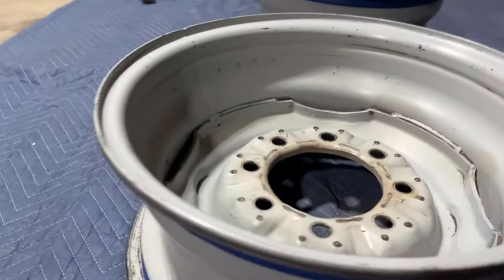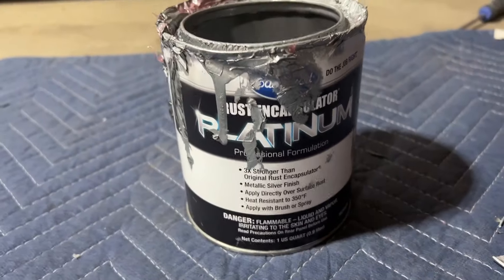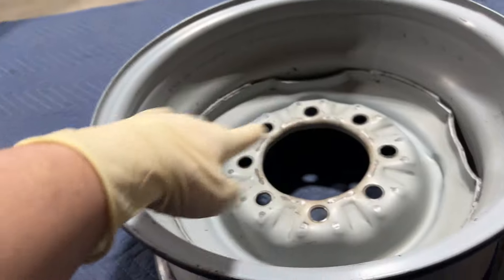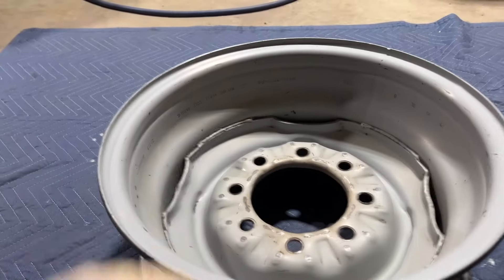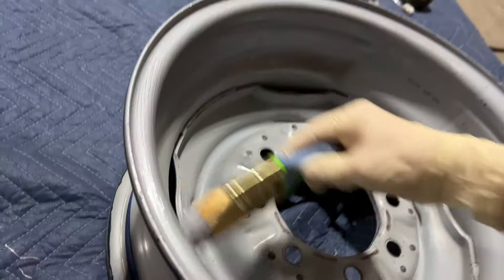The wheels are all prepped and ready to go. I went ahead and masked off the bead sealing surface, since it's already smooth and in pretty good shape and holds air really well — I just didn't want to risk getting any paint on it, especially since I'm brushing on the back side. For the back side I'm going to be brushing on some Eastwood Rust Encapsulator Platinum. That's for the little bits of rust on there. I really like this paint — you can apply it over well-prepared rust or metal, and I haven't had any problems painting it over stuff that's already coated. I'm going to brush on a nice medium coat just on the back side.